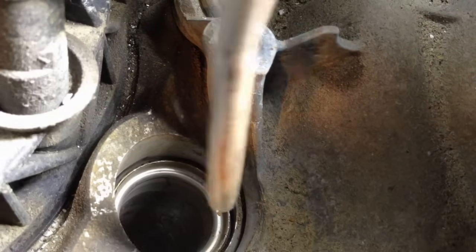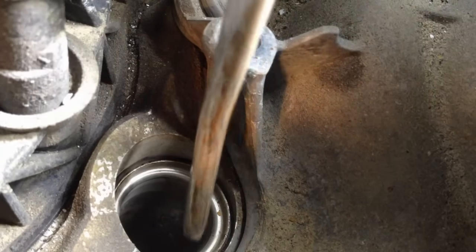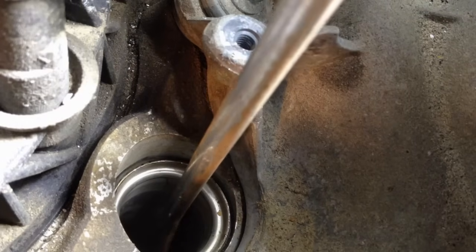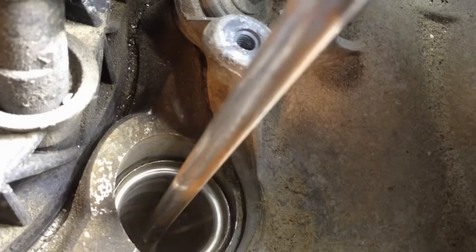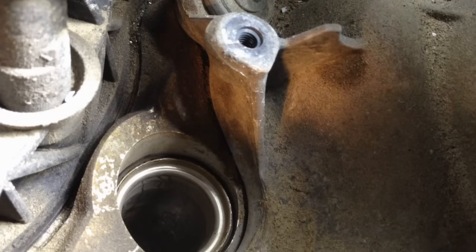Go ahead and blow out the cylinder — you can use a long-reach blow gun to get way down in there, put the pressure in the cylinder, and hopefully get the porcelain out the same hole. As I said before, I've had pieces like that or smaller go in there and they pass through the valves just fine — no damage, no issues, not even a misfire on start. They just crunch up and pass through without damage, so it's not a huge issue. The less the better obviously, but it does happen depending on how the plug breaks. You have no control over that — the best you can do is follow this procedure to avoid the breakage in the first place.